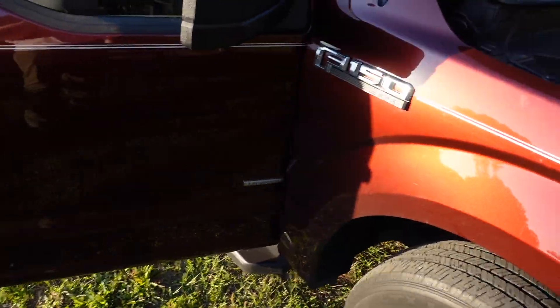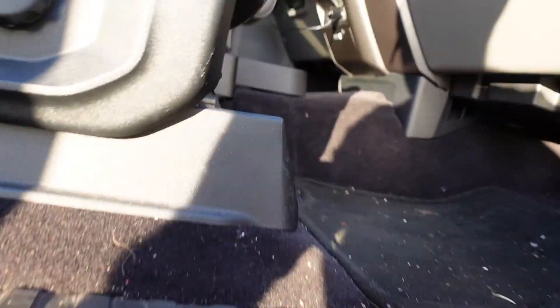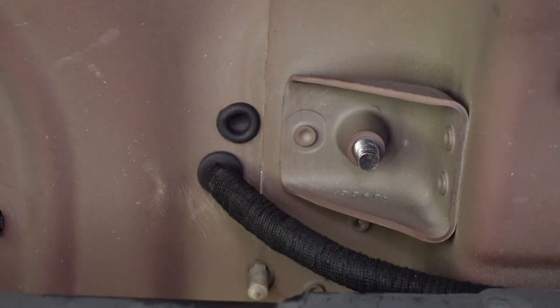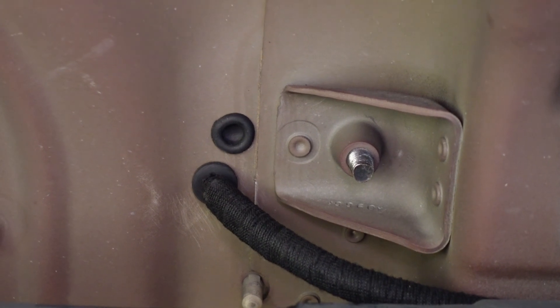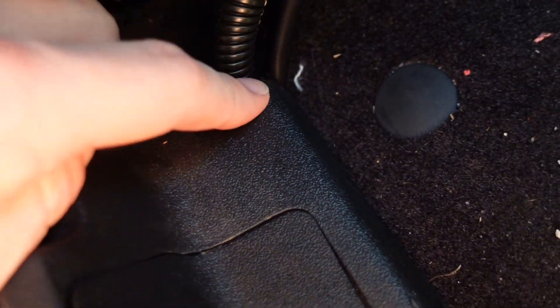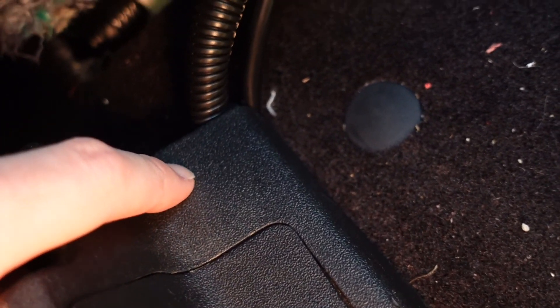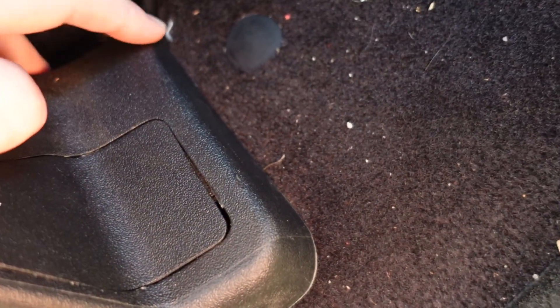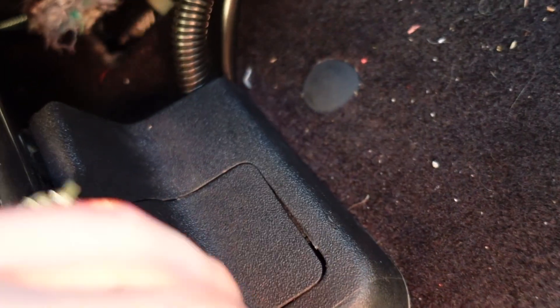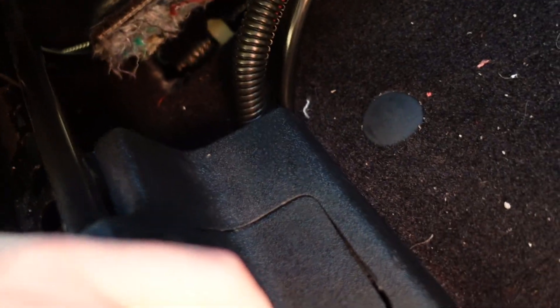Be real careful — make sure you've got a good ground connection from your bolts back to the inverter. As for the location of that drill hole — you can see how it's offset from the seat bolt post by about two inches. The natural place for it, once you get the cover off, is right at this corner. Be careful — originally I drilled the hole right around here thinking there was a recess in the bottom of this plate that secures the seat rail to the body, but there really isn't enough of a recess there. If you get over here in this corner, you can see those wires are nice and free, not rubbing on anything, and we've got the extra protection on there just in case.